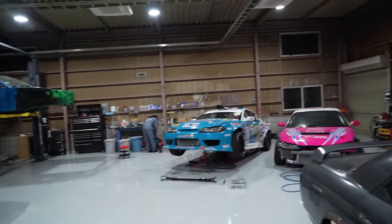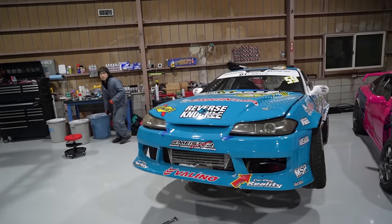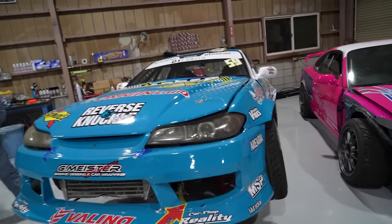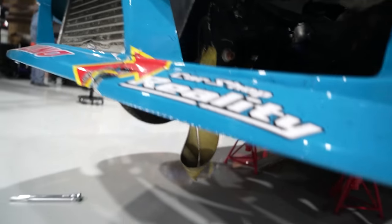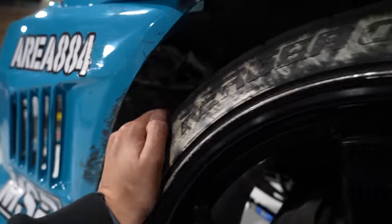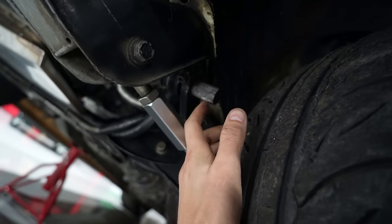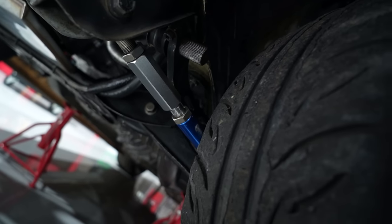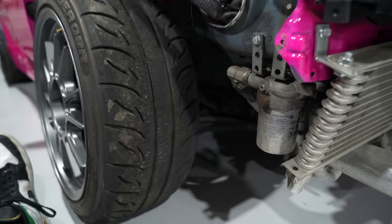Daiki's been really busy getting his car prepped for a practice session this weekend. They have D1 Central tomorrow and also on Sunday, so he's going to take his car for a test. He hasn't run a front sway bar before, so I gave him the old GK Tech one that came off the abandoned S15 to test out. The best thing about them is their massive clearance - you can have a full angle kit on here and at full lock it won't hit the sway bar whatsoever because of these splines. Normally the stock one comes out way further and his wheel would be smashing on it.